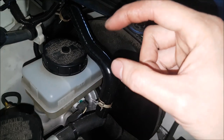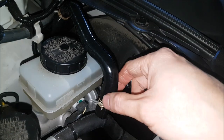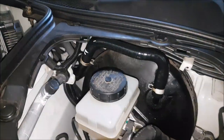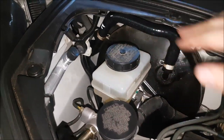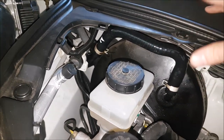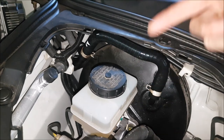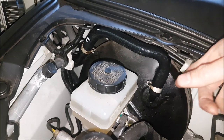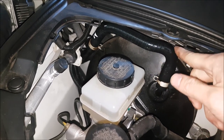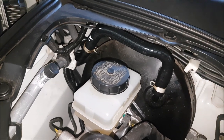Or you can use a worm clamp as well. I prefer to use these though because they do work. The worm clamps can dig into the material a little bit, so I try to use the factory clamps whenever I can. Clamps are in, we have the clearance that we need, we put the cover back on. It doesn't matter if you get these from Z1 or Mishimoto or whatever. When you're dealing with silicone hoses, the nice thing is they are easy to take on and off. Unlike the rubber ones — if you've ever tried to take off the rubber ones, you end up cutting them to get them off. The cool thing about these is they come off easy, go back on easy, and they'll pretty much outlast the car.